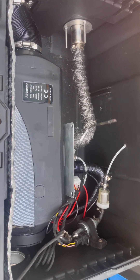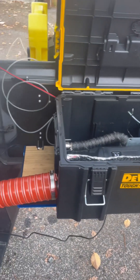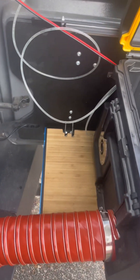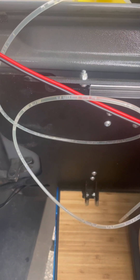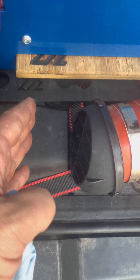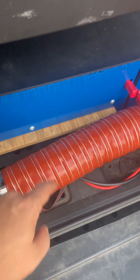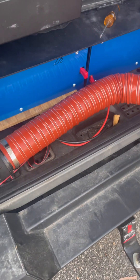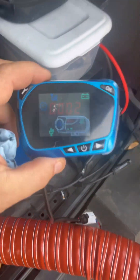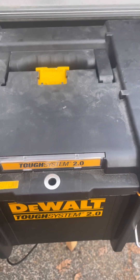From there I can just close the lid — the cable comes out without impacting it at all, it's a pretty easy cable, and then I can control it. The thing turns on great. Here it is running — you might see a little bit coming out the exhaust here; this isn't where I normally run it. You'll notice the fuel moving, there's a little bit of ticking I mentioned, and it's already pushing hot air. Note that the hose can get a little warm. That's the diesel heater setup.